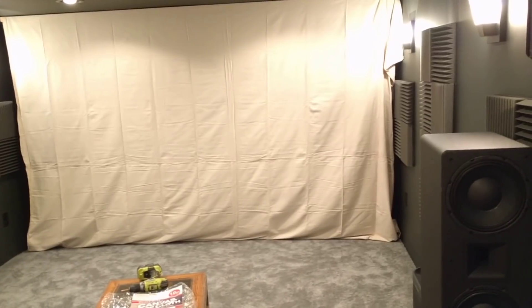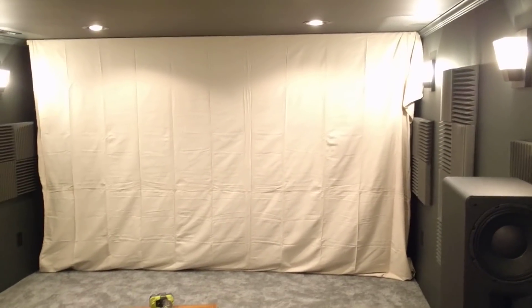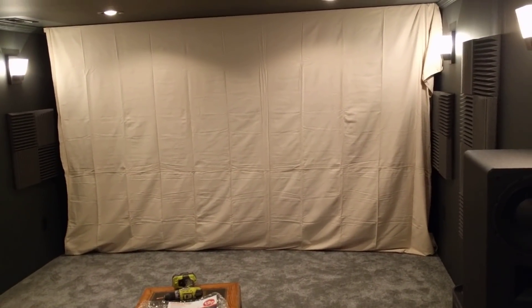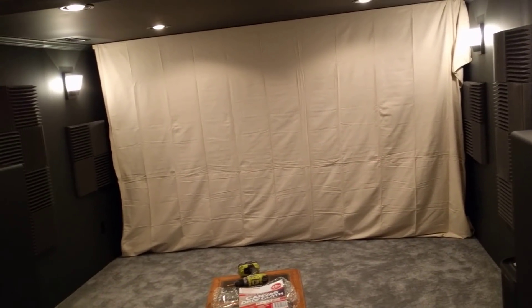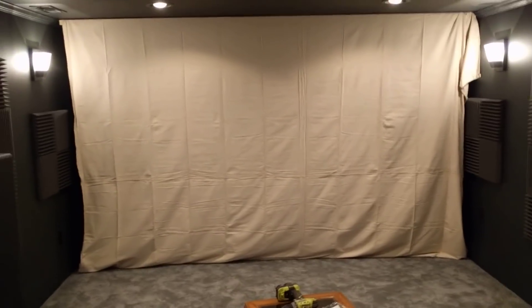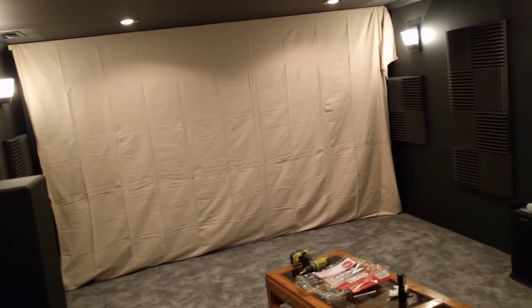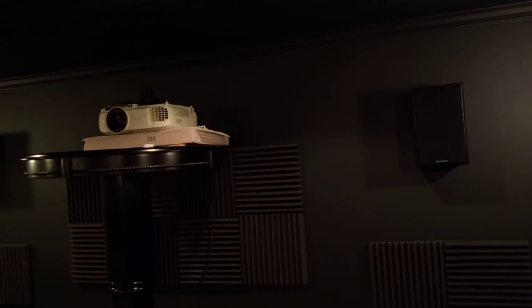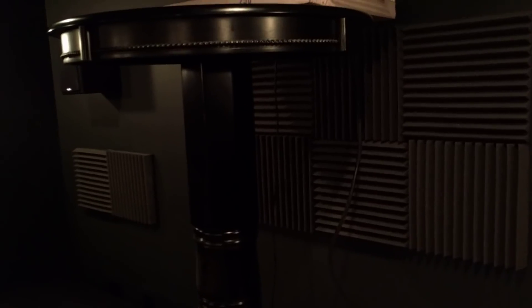Recently, the past few weeks or so, in eco mode at low lamp power, the screen started to flicker. The lamp was flickering from a high to a low power over and over. It's intermittent, it's extremely distracting, it's hard to watch — it's almost migraine-inducing. But as soon as you switch it to high lamp power, problem gone. I did some research online. This is not specific to this projector — it is specific to a UHP type bulb, which basically all projectors have or use, except super high-end laser-based projectors.